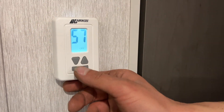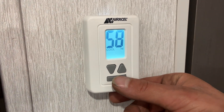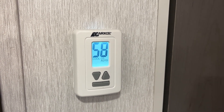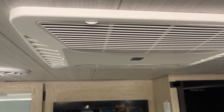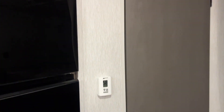Up on the wall is your thermostat. Touch that bottom bar to wake it up. It first comes into fan speed — low and high just move some air around. Cool high means the high fan is on all the time, cooling as needed. Cool low is the low fan all the time. Cool low auto means it becomes an on-demand system — the compressor and fan cut in and out as needed using only the low fan. Cool high auto is the same but uses the high fan. With the air conditioner going, you can have these two louvers closed to use all your ceiling ducting, or open them up and dump all the air into the living area. When you first arrive at your campsite, open those louvers to cool off quickly, then close them to move air throughout.